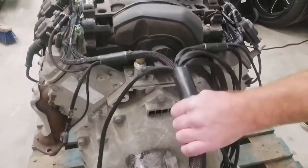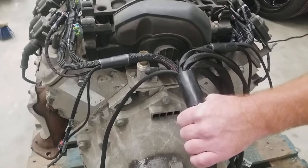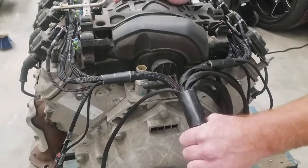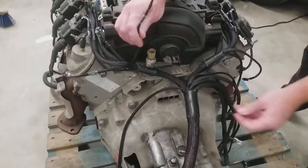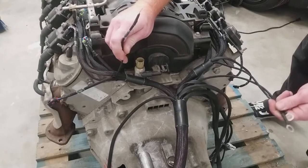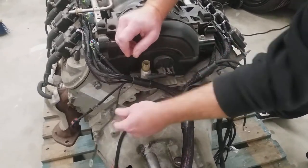This main merger has got to sit basically right in the center of the intake manifold at the rear of the motor. This is going to give you good ample length to plug in your injectors, coils, and those items. You're going to want to make sure you ground these three ring terminals here at the back of the cylinder heads. These are important because they ground the coils and they're also the main ground for the engine harness.